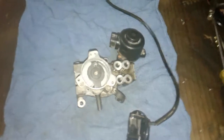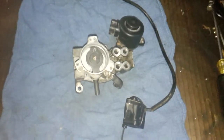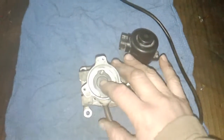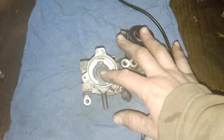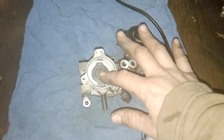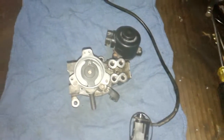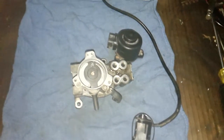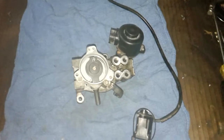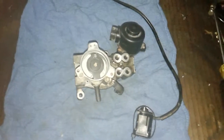It's throwing a code for the sensor, telling the computer that you're not getting enough oil feeding into your rotary housings — which is the case. We're backed all the way out at minimum oil flow, and then it plunges all the way in to apply maximum oil flow. We're going to give it a constant maximum oil flow, and the only downside is possibly some additional carbon buildup in the long run, some additional oil usage, and possibly fouling plugs — but it's going to beat the alternative.